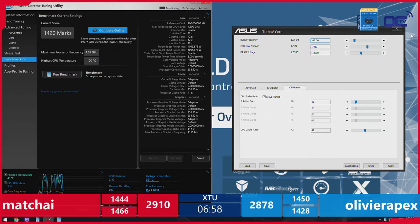So that's also why we talked about the slow mode tweak. Slow mode tweak indeed is when you're really pushing it hard. You can push or flip a switch. And what it tells the system, in fact, is that the CPU was overheating. So it will throttle down to, I think it was 1600 megahertz with Skylake. And you can just complete the benchmark at 1600 megahertz. It has been very useful, in fact, for the extreme guys. If you could do 5 to 10 seconds in XTU, flip that switch, it would take a long time before the benchmark finishes, but at least it didn't crash. Plus, you had two or three loops at a very high frequency giving you a total score. So the benchmark is what we call tweakable as well.